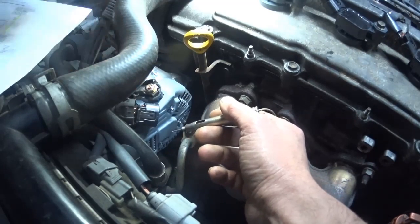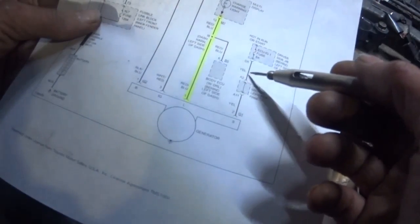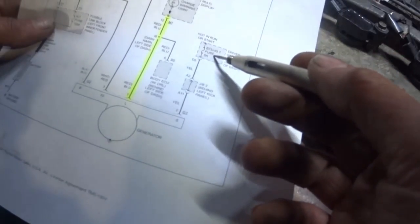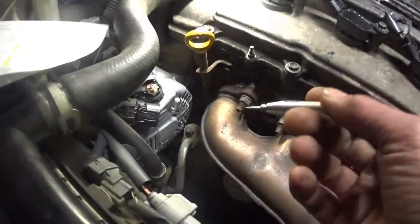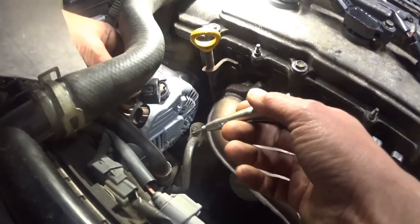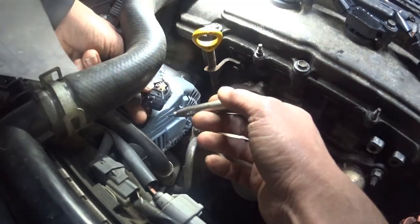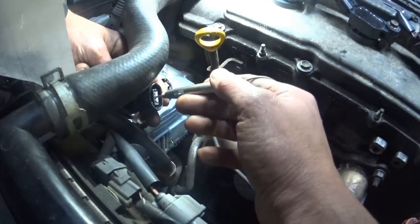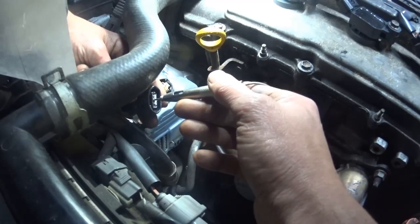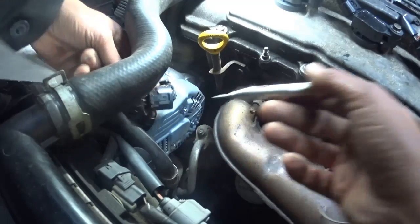And the last but not least here is the yellow, coming from the ECU ignition one fuse. That has to have power with the key on or running. So we're going to go to the middle terminal — we should have power here. The light's working but we have no power there.